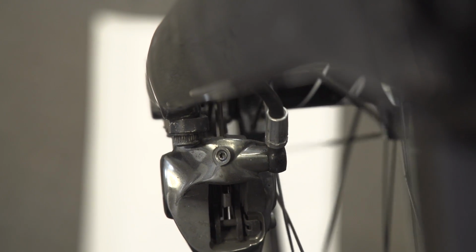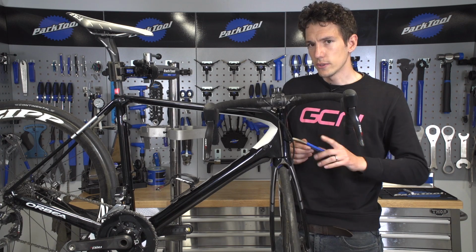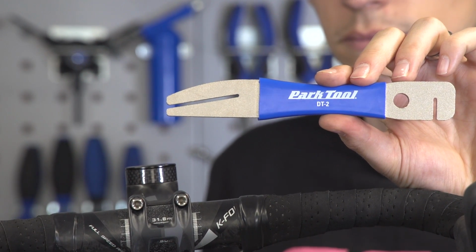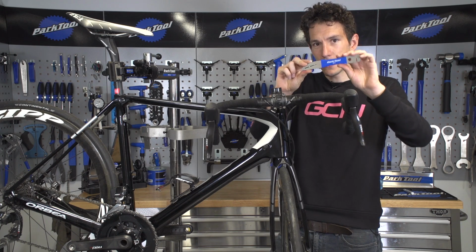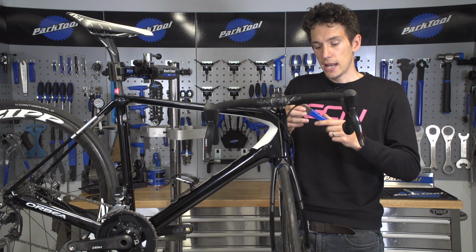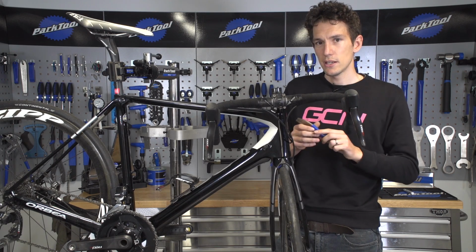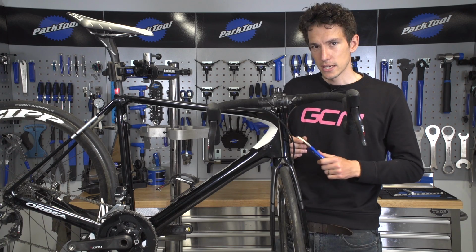Okay, it's time to actually true things up now, and I'll admit there isn't a great deal of science to this. Ideally, you would have one of these, which is a rotor truing tool, and it fits over the end of the rotor, and then you simply bend the rotor very gently in the direction that you want to move it. And you'll find that they're relatively resistant to small tweaks, so you may need to spend a bit of time actually moving it into the desired position.